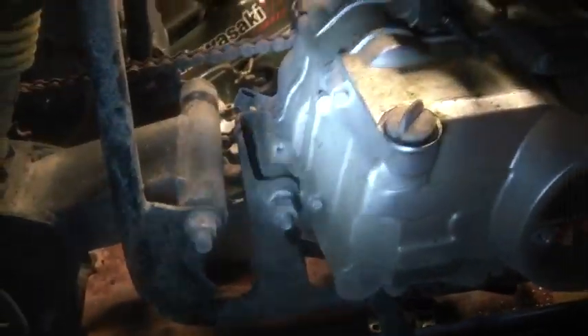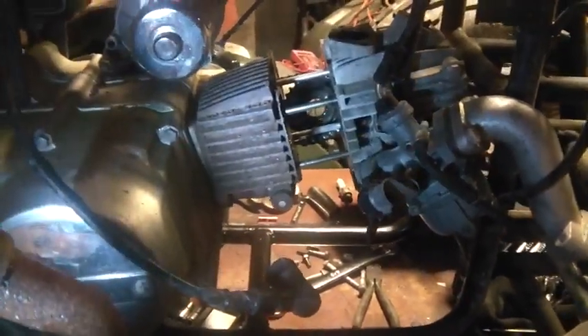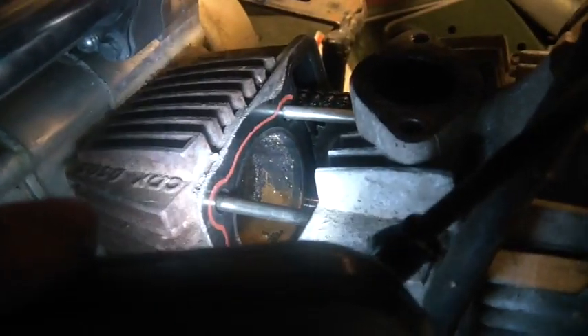It's really not trivial, but I'm going to finish taking it off. Looks like just two bolts hold the engine on — wow, just two. I guess it's only 70cc — I mean, what is that, a couple of two or three horsepower? Anyway, I'm going to obviously drain the oil, pull the engine, clean up that bore, and see if I can't get this thing fired up.